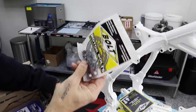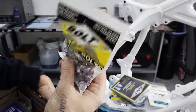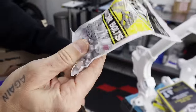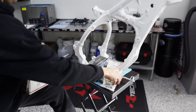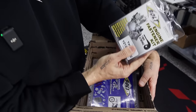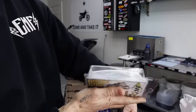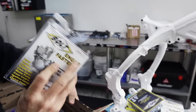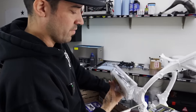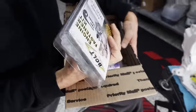There's the service pack — holy smokes. We got 10 M8, 1.25 by 16 by 20 — look at all that. So just if there's anything not in the pro pack you guys are covered. These will hold your exhaust hangers, subframe bolts, pinch bolts for your axle. I had never seen these until now — that's awesome. We also got rotor bolts, and on the Yamaha we got the countersunk head, already with some thread locker on them. What hasn't Dave covered on this chassis in this pack? Well we have the engine — full engine fastener kit. These things are amazing — dimple headed, fresh and bright. We got crush washers for oil checks, domes for the cylinder head, copper for the heads too.